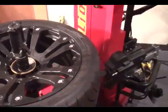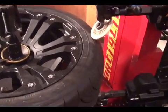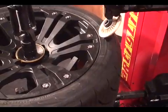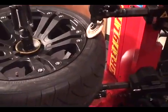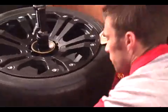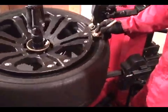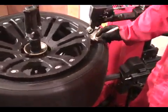The first step will be to set the bead breaker distance, so I just go as close as possible to the tire. With these two switches, as you can see, I can control a very small movement. I just go close to the edge, and with the bottom I can open the roller and go right underneath the edge and start spinning. Always apply lube while doing this. Keep coming down and make sure the bead is all unglued from the rim.